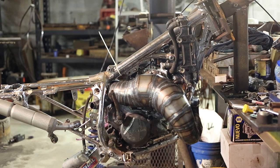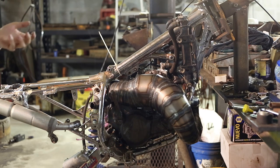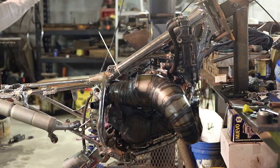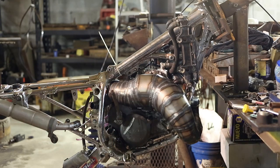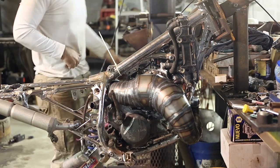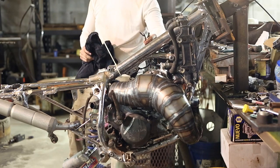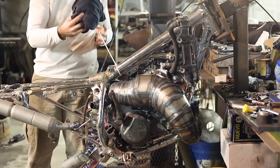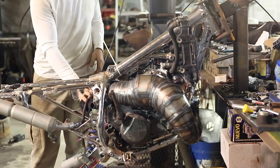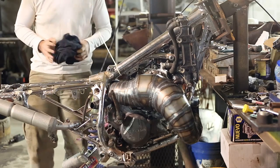I've pretty much got everything bolted together on the Rotax. I've got the exhaust hung on a spring, got carburetor gas in it, just put some cooling in it. I have the wiring kind of ghetto-ly stuck up in the frame — we'll see some pictures of that later on. There's two bare wires hanging out over here for the kill switch. I don't have a kill switch; this rag you see here, I'm hoping I will stuff in the carburetor as my kill switch right now, which is admittedly kind of precarious even for me.